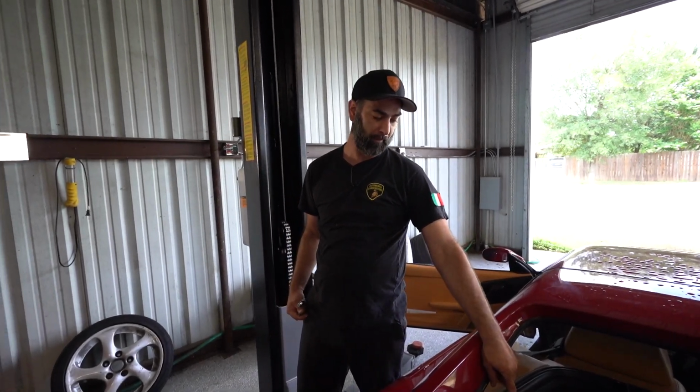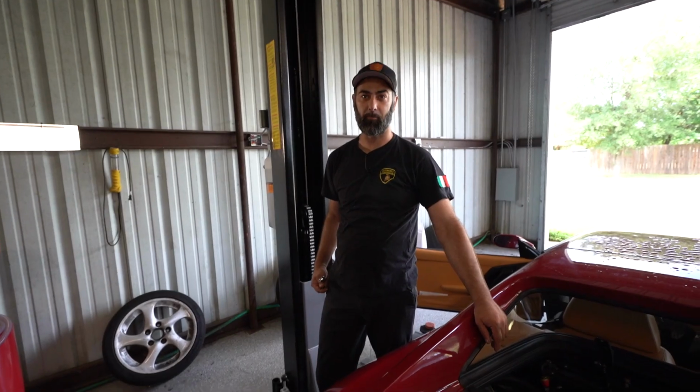Wow. On those two cylinders, and the rest will be like 190-ish. When you go past that point, and now you have less, the motor's wrecked. Now you've had fuel washing out the cylinders and all that. But yeah, the first clue is the fact they have excessively high compression. That's really interesting.